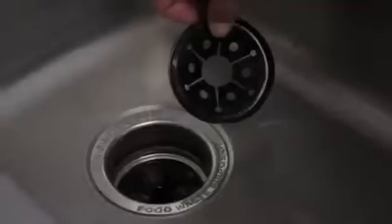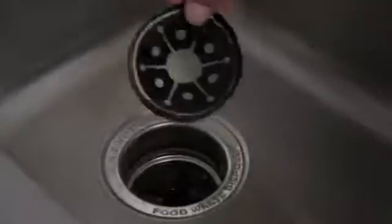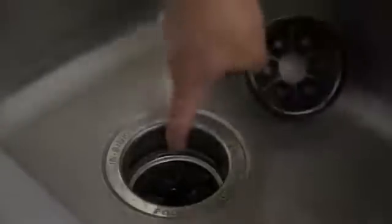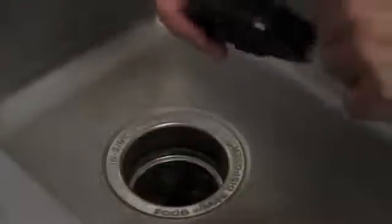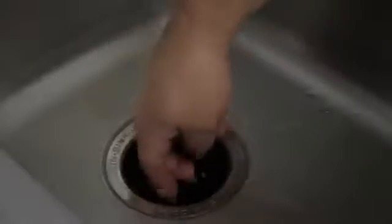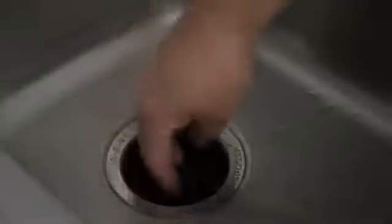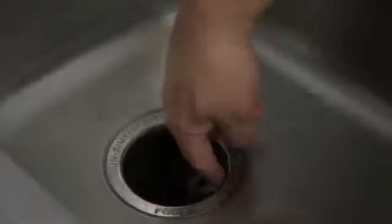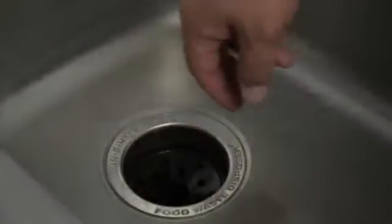In some cases, you won't want to do what we just demonstrated. You may, if you wish, purchase an accessory splash guard that can simply be inserted into this ring, this groove right here, and simply push that down. This will create a splash guard for you so that you don't have to pull all the disposal all the way down. If you already have this splash guard, the original one, it's in good condition, you can still add these and that'll make your disposal quieter.